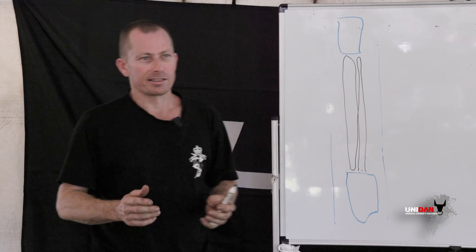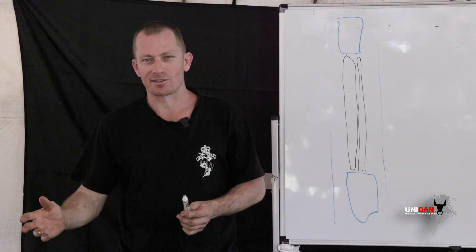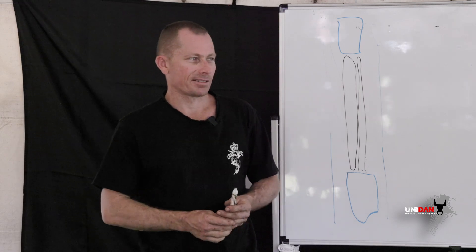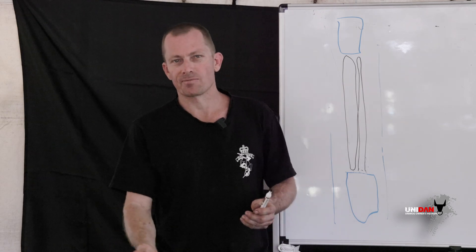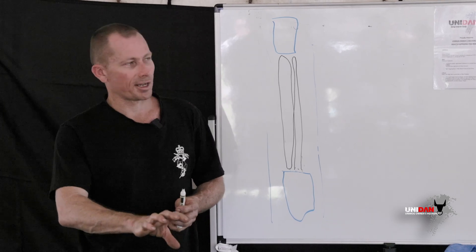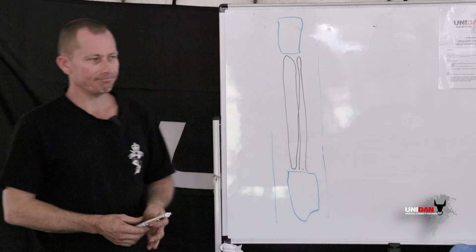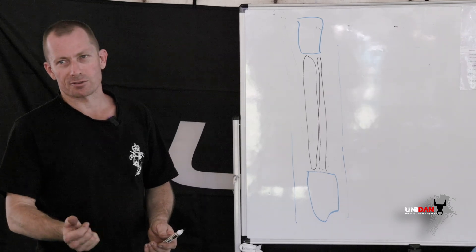A common mistake I get from students in the ADF — they're taught safety, safety, safety. They've done their tire-changing exercise on a nice concrete surface, and they think wheel chocks. I'm bogged, I'm stuck on a hill — get some wheel chocks out. It's the last thing you want to do. If you're on a rocky surface, metal, plastic, or rubber wheel chocks will slide on the rock surface before your tire will. You're better off with just your tire and its traction, especially with deflated tires. In mud, the wheel chock will just get pushed into the ground and you'll lose it. Anything jammed under the tires just reduces your traction.